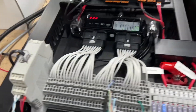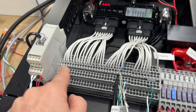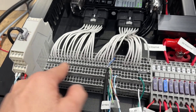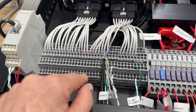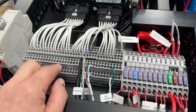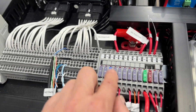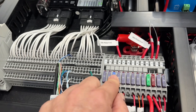A new feature we're doing now is we've simplified the wiring going into the digital switching. This is all Wago along here now, and these are much smaller than we had before and easier to install. All the customer does here is pair each connection — negative on the bottom, positive up here — and our CAN wiring here has a joiner switch on. It's very sleek.